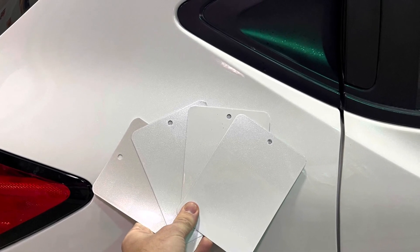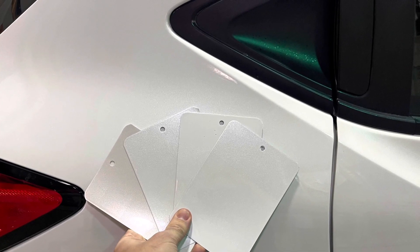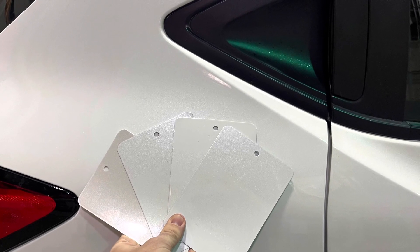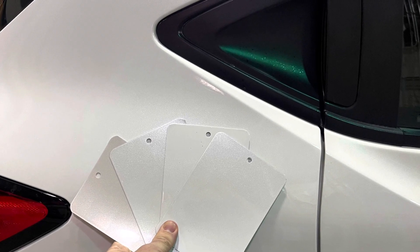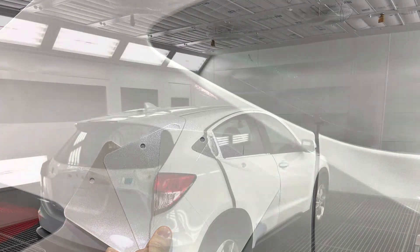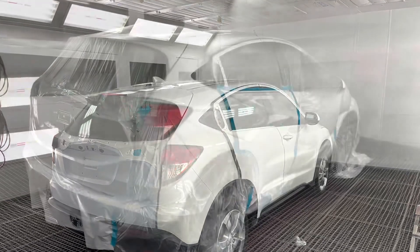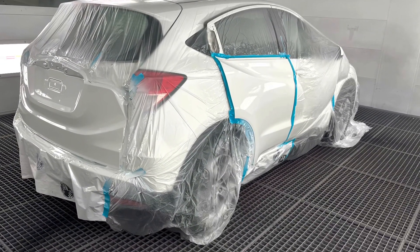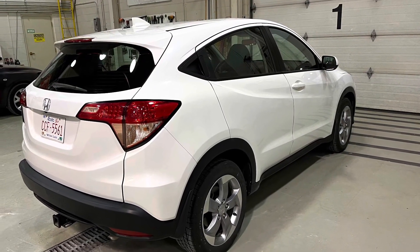One really unique thing about this system is I can actually do what's called a correction step — meaning once I've sprayed my spray out card, I can do another camera reading on it and this software will actually retint the color as needed for me. That's a bit of an advanced process that can be taught by your instructor or paint supplier. Once it's done, you can prepare and mask the vehicle, paint it, and then of course appreciate your work once it's finished. And that's how we do our color matching with the spectrophotometer. Thank you for watching.